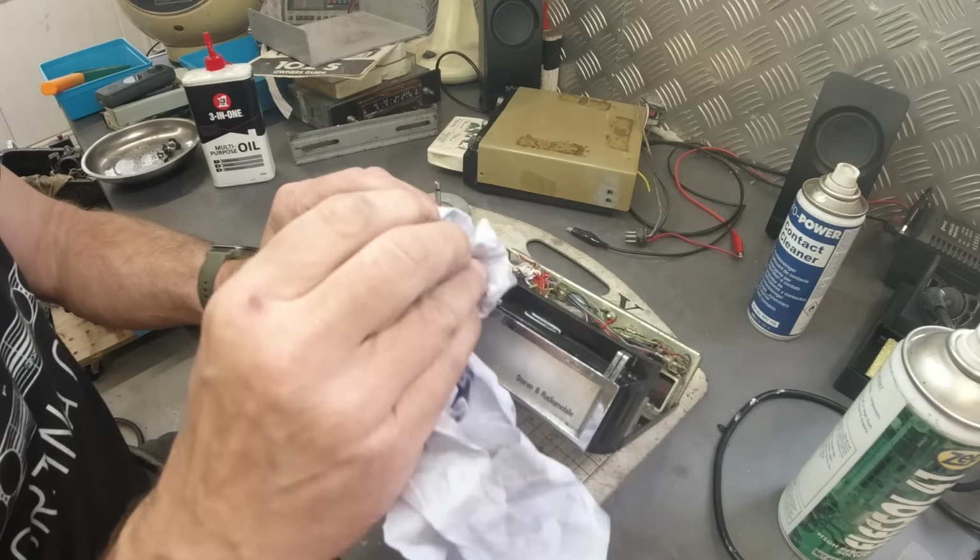It should work. But if you're going to do this, what I've learned so far on this journey, folks, you've been with me as we've done it, is that there's no point just putting a tape in off the shelf. This tape's coming off eBay, random. We don't know the condition of it or anything. It's best to just take the tape apart and service the cassette or the cart first before you put it in here, because you can just end up with a false reading. In other words, if this tape's tight, this is going to play slow. So really you need to have a fighting chance that your cart is okay. And they're quite easy to service. I've learned how to service these pretty quick, and I'm going to take you through a quick 8-track tape service right now.